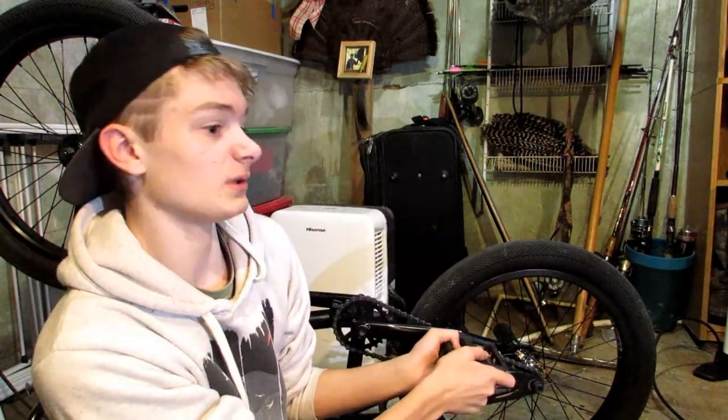— after a few months of riding it, just take a peek inside your driver and make sure your pawls are not getting worn out, because it does create a lot of friction and you don't want that wearing out your teeth. But if you have 25 cents to spare, you can easily order a whole packet of brand new parts — very cheap. I wouldn't suggest bending the springs so tight that you can barely get it to turn just to make it loud, because it will hurt your hub.